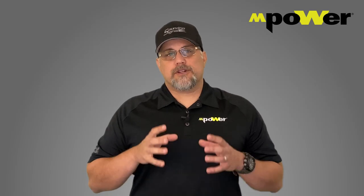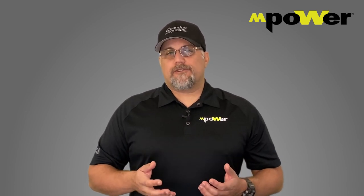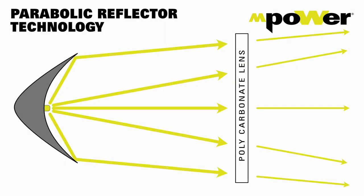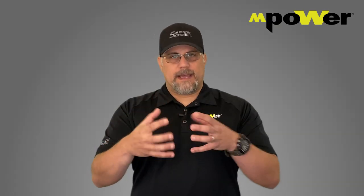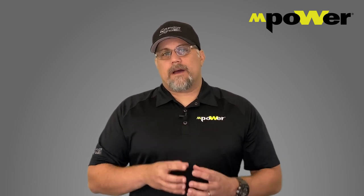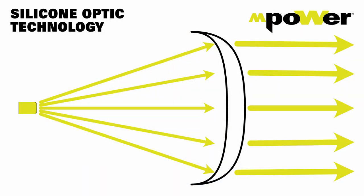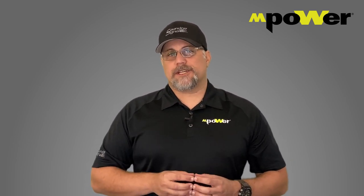The next part is projection — how does that light project? Typically in the off-road industry, we see lights with parabolic reflectors that create projection, and that parabolic reflector is going through a piece of polycarbonate glass that protects the whole light assembly. With the Empower Off-Road Lightbars, we're using silicone, which is different than everything else out there. Silicone, when molded properly into an optic, creates a clearer, more precise light and can be magnified by the optic itself. So we start with a high-powered LED and put it behind an optic that focuses and magnifies that light, giving you much further projection.